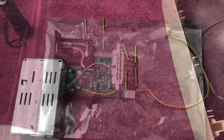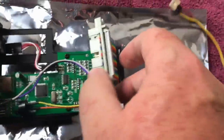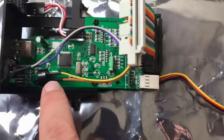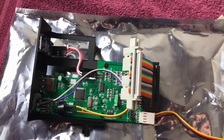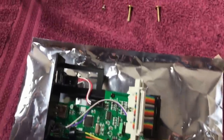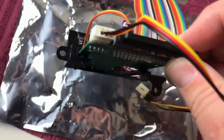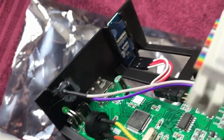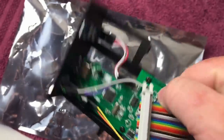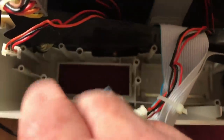Let's go grab my GoTek stuff. Here is my GoTek drive already mounted in my 3D printed case. I've got my ribbon cable plugged in, my power cable, and I also wired up a piezo speaker so you can hear the floppy sounds — I can turn that on or off in FlashFloppy. I'll put a link in the description to FlashFloppy so you'll know what to use to flash your GoTek drive. My bracket has one mount here and one mount over there, so I'm only going to be using two screws. I've got my buttons and OLED screen secured with hot glue, and we're going to install it down in here.